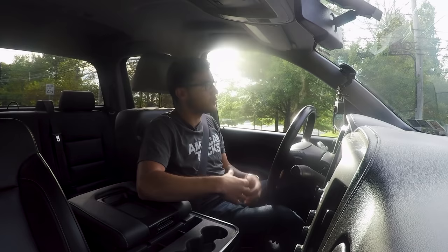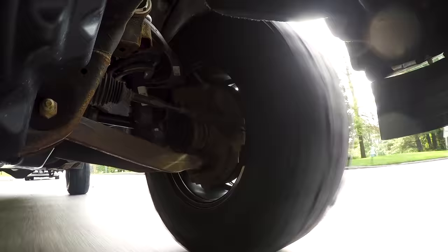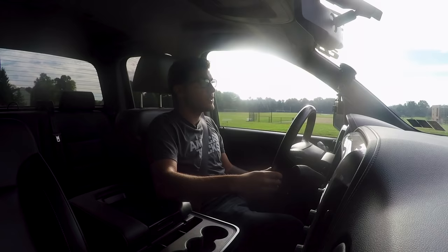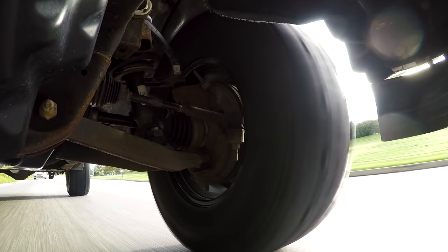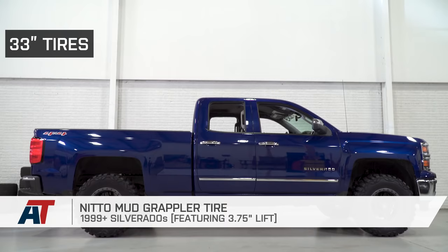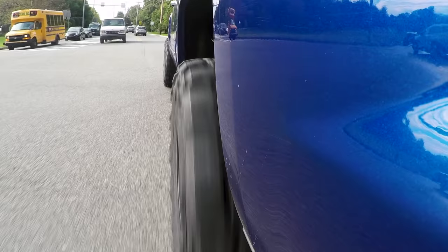I did notice it was a little sluggish — obviously that's going to happen with bigger, heavier, wider tires. Plus the nubby mud terrain tread adds a little bit of resistance. What you make up for in that downfall is off-road performance. When you get off-road, not only are you getting added clearance with the lift, you're adding two inches of tire under your suspension, giving you more off-road clearance. You'll go over logs, smaller rocks, or whatever a little bit easier because those stock 31s just don't have the traction or the height clearance. As far as looks go, the 33s look pretty badass and they're just an easier route to take — throw them on a lift like this and you're hitting the roads and the trails, good to go.